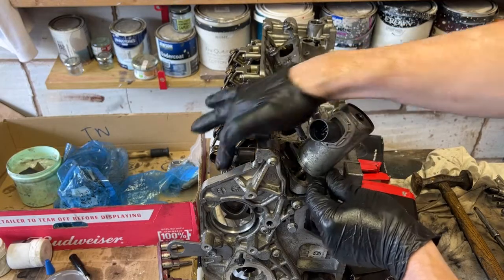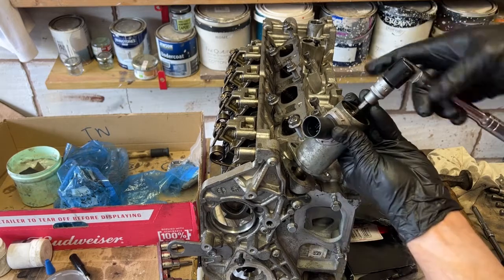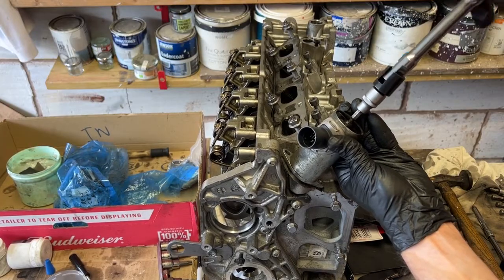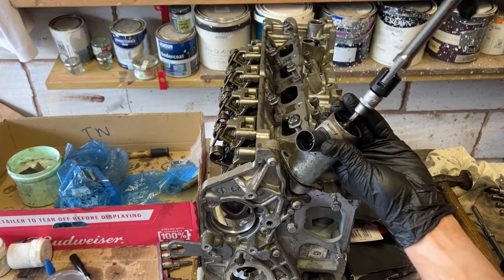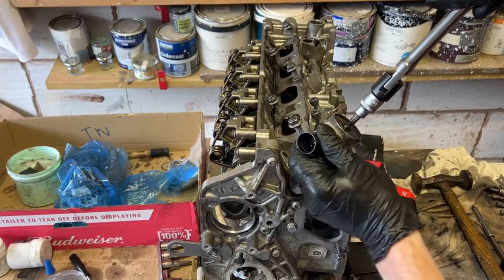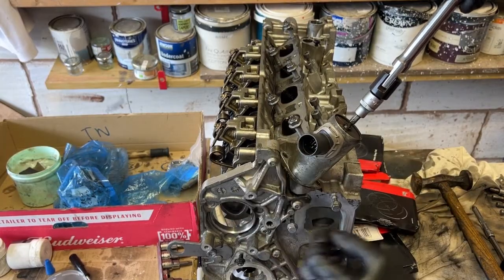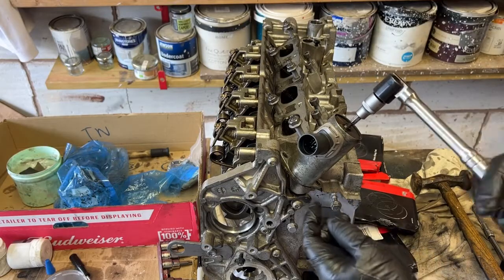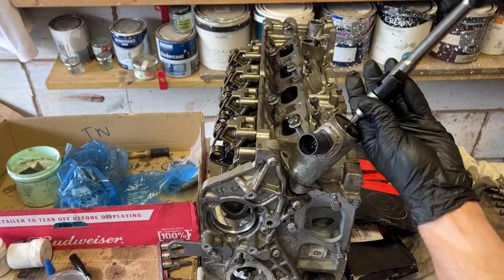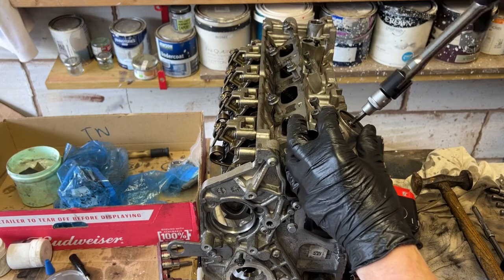The intermediate shaft is just to rotate this and it's going to wind it on — you can see it's been wound in. Now it's in contact with the head, so I can do my two bolts up. Once it's touching, I can do the two bolts up and then rotate this around to approximately the position where the shaft was when I took the cylinder head off.